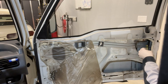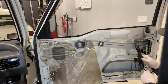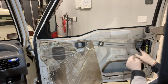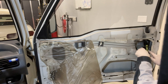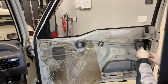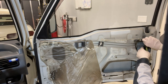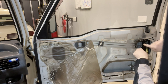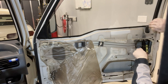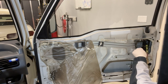We've got our bracket mounted. To show you how the door actuator goes in — it basically slips up and under here, and we'll mount it on that bracket as far as we can this way so it doesn't interfere with the window. From there, the rod provided with the kit attaches to this rod right here and will allow it to go up and down once everything is wired in.